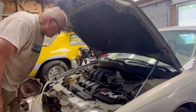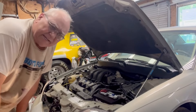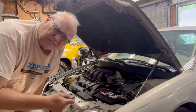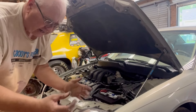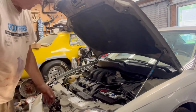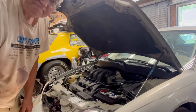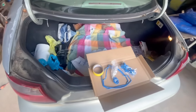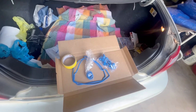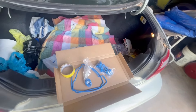We'll let it run for a few minutes. As far as that coil pack, I think we're okay — until I get on the highway and get a load on it I won't know for sure, but the rubber boot just popped back in and went onto the spark plug no problem. While I'm letting the engine run and get some heat in it to check for leaks, I'm going to put the unused valve cover gasket and grommets back in the box, tape it up, and put it in the trunk of the car in case I need it.